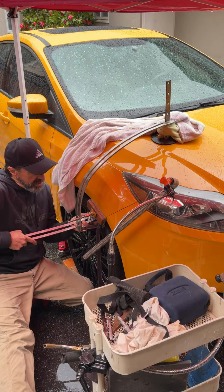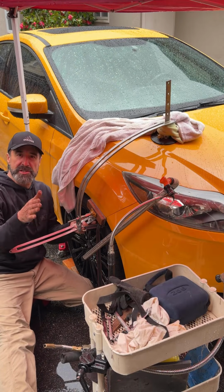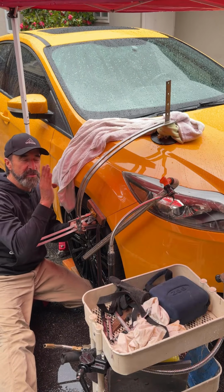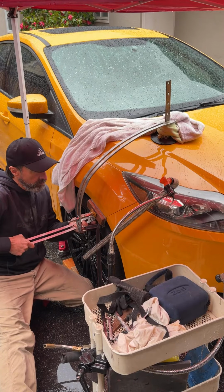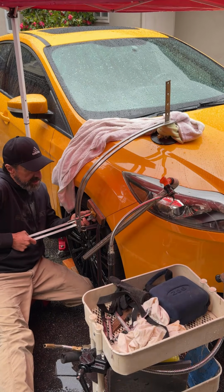So what I'm doing right now is as I'm pushing, I'm sliding the tip, and it's basically building this body line by just sliding it back out. When you're working a body line, you don't want to pick at it, because you'll make these stitches that you now have to get in between. I don't like to do that. I like to make sure I'm sliding, always sliding.